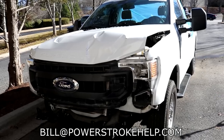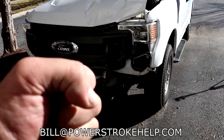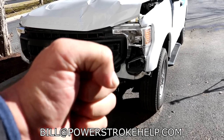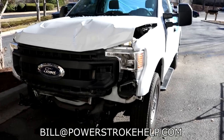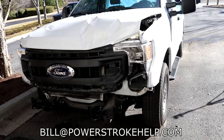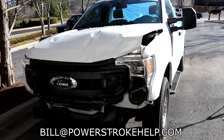I have a hood and a few other pieces that I can rebuild this truck with, but it requires a frame pull in this direction to bring this part back. It takes triple the force to move an aluminum piece as it does a steel piece — with steel you can use a frame puller and it'll just come right out. Whereas with this one, you really feel the frame machine struggling, and that becomes extremely dangerous. As you apply more force, if the chain or clamp device lets loose, that will sling across the shop and hurt somebody.